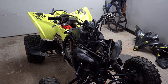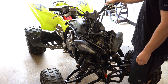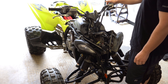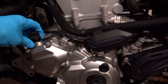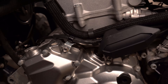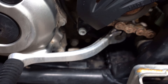Alright, so we've got our first step. We're going to start with the oil change. The first step is to let the bike idle probably just a couple minutes, just to get the oil moving. So step two on the YFZ, we're going to open up the dipstick so that way it can get some air in. The YFZ has two drain plugs, one on the front of the motor and then one right there behind the shifter. We're going to let both of those drain.